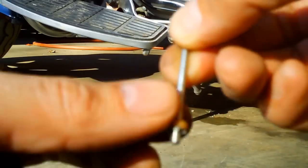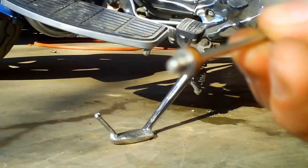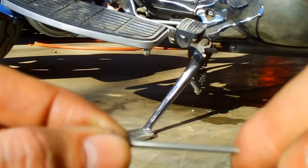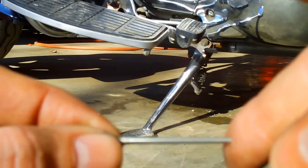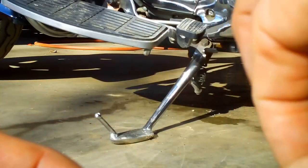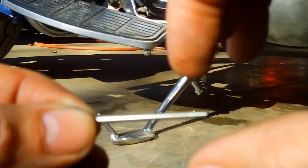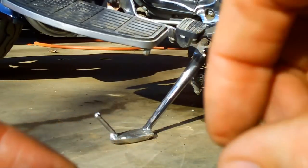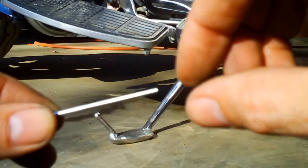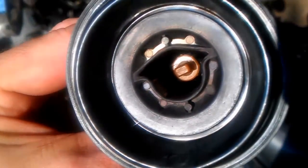Slide the plastic spacer back on again and press it down against the clip and the little washer we put on. What that does is raise the needle up just ever so slightly out of the secondary jet, and because of that extra distance it will now let more gasoline flow through the jet itself around the stainless steel needle as the air goes by — so it'll grab more fuel. With the needle shimmed, it lifts up a little bit, lets more gas in with the air, and that's why you shim the jets.